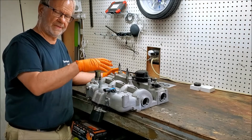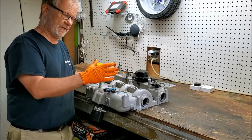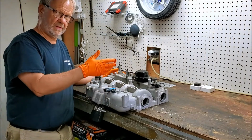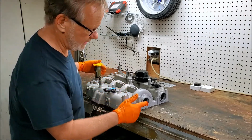The rocker arms are placed and just rested on top of the cams, on top of the valves, and then we have to place this on without disturbing them and get it all bolted on and make sure that they are in the right places. So we'll see that. But for now, we have to put some cam seals in and the end caps.